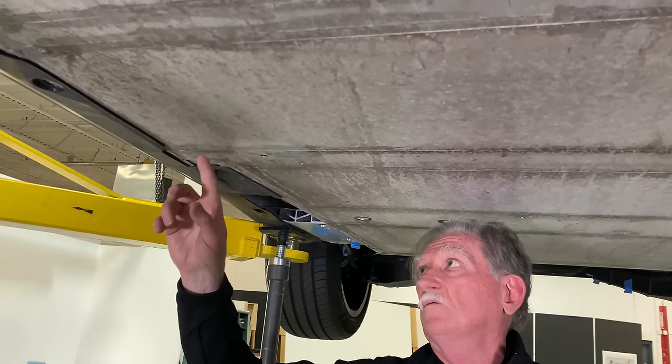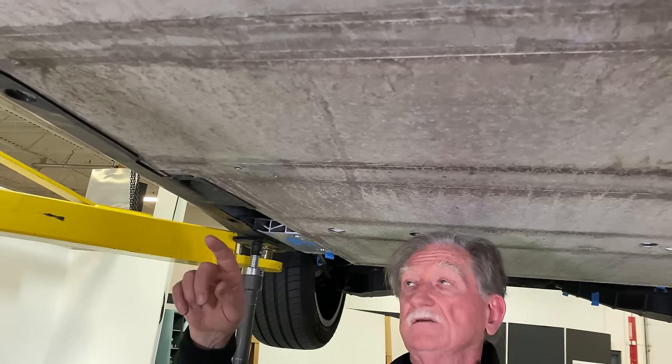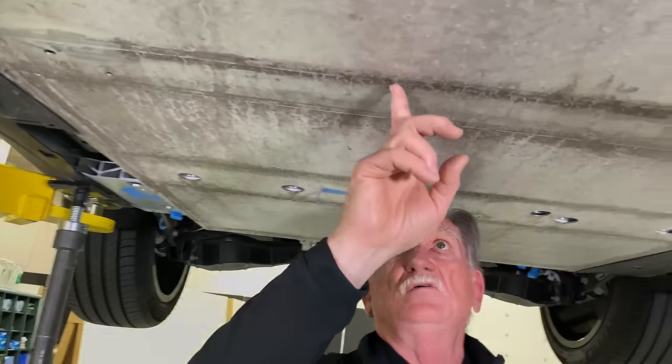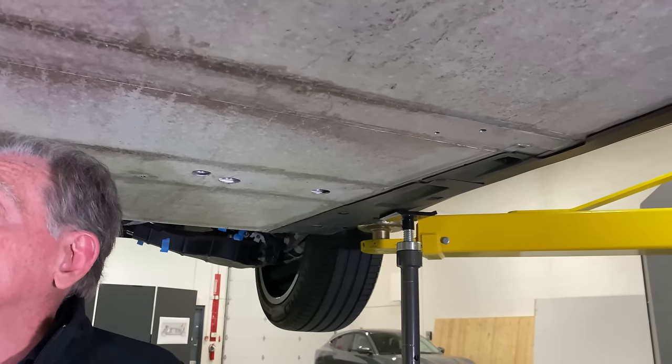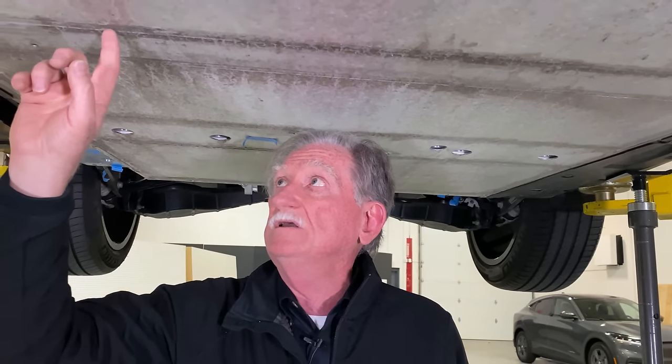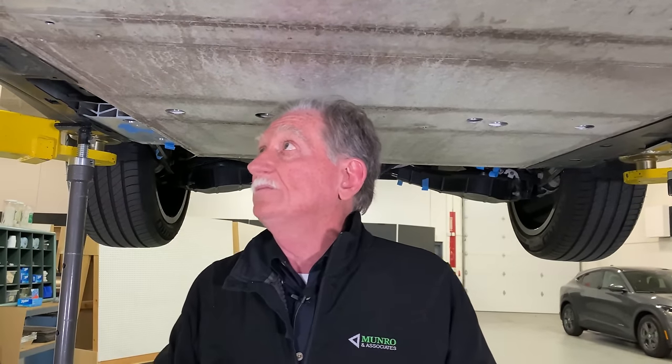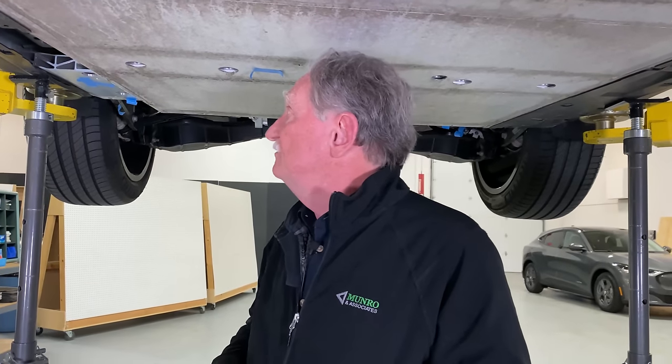So by doing this, you make sure that you keep your panel straight, and it doesn't cost you anything. This is not welding like what you saw in the front, arc welding. This, you spin and you move and you move and you move. What it does is it spins this material and that material into a common material, which makes that joint like the same piece. It's the same piece now.